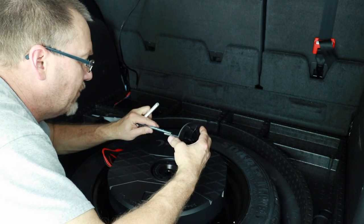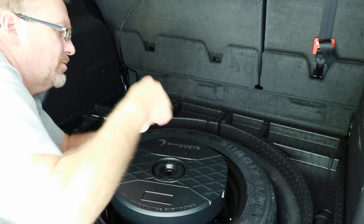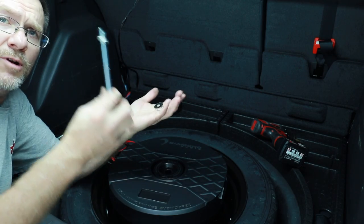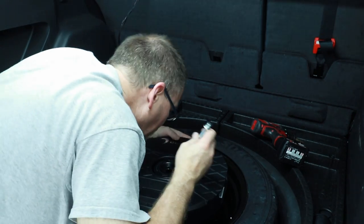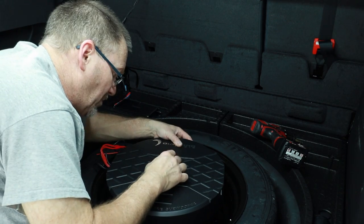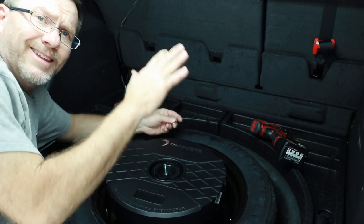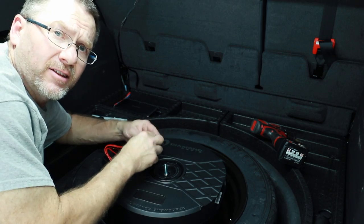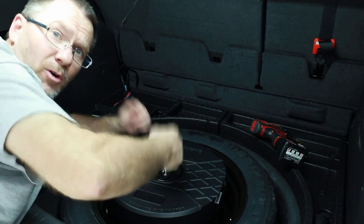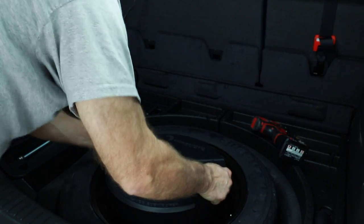Comparing it to our factory bolt, it looks like this is the thinner one. The butterfly nut on top lets you set a custom height and trim it if needed. Loosen the two off, take the butterfly and washer off, leave the nut on the stem, and thread it back through. Like all spare tires, just roll it down until it's all the way seated, then spin the bolt down level. The whole secret to these enclosures is their ability to couple with the car — it needs to become part of it. It must be super tight; you should be able to grab it and feel it lift the whole car.